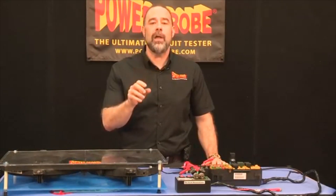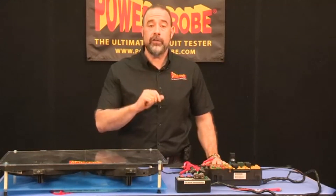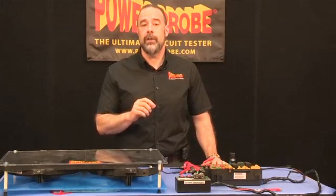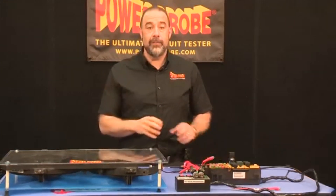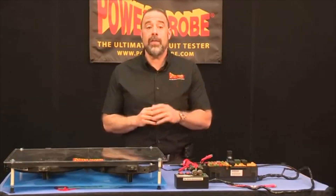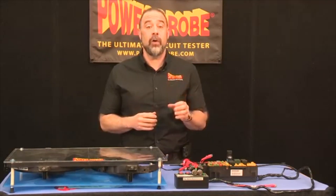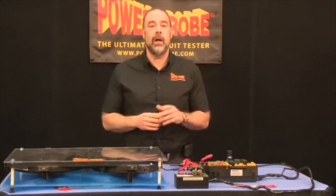This is the hook's way of alerting you, the tech, that a condition may not be safe to apply full current to the circuit. If the circuit you are on is arcing, the hook will limit the amount of current to the circuit and alert you with a fast toggle tone. So if the switch arcs, if the motor is worn and the brushes produce a spark, or possibly a wire that is touching ground that is arcing, the hook will protect the circuit and the technician. This way the technician can decide to override this mode or investigate before doing damage, possibly creating an unsafe condition.